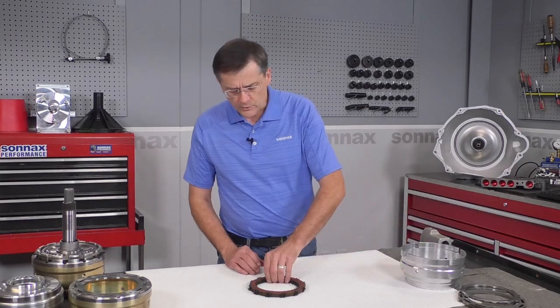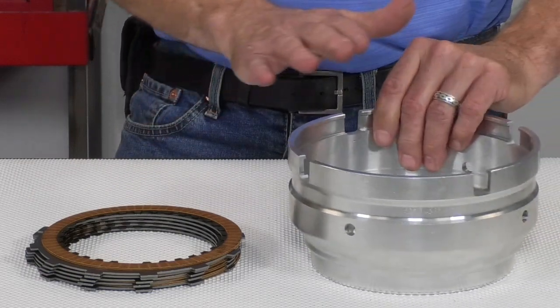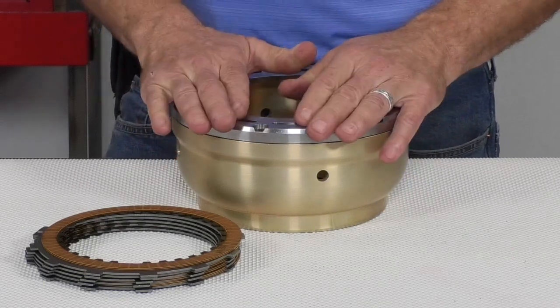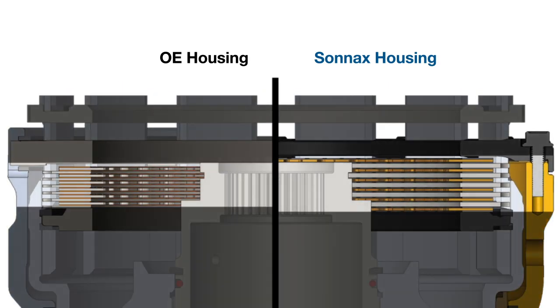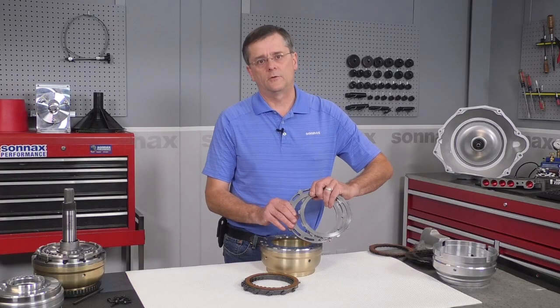What's required is conventional double-sided clutches, but the problem is they just won't fit in a stock type housing. So what we've come up with is the SmartTek housing with its unique bolt-on plate. Between the bolt-on feature and eliminating the snap rings, we've built in about 3/16ths of an inch or 5 millimeters of additional clutch height capacity, without resorting to machining down the clutch plates, which can make them thinner and introduce more flex into the system.